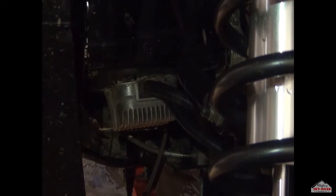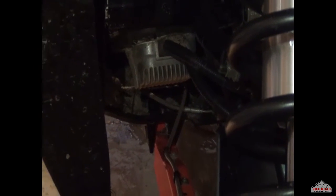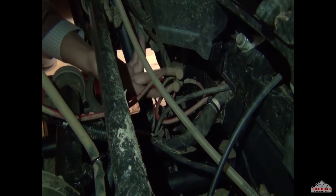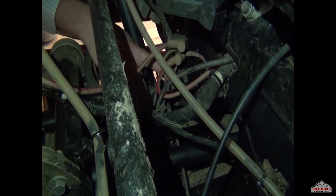So we're in the back of the machine. This is the voltage regulator right here. We're going to cover everything from scratch. This is the stock location. There are two separate conduits — one has the power and ground in it, the other has the three-wire yellow piece in it. You're going to need to undo both of these to be able to remove the regulator.